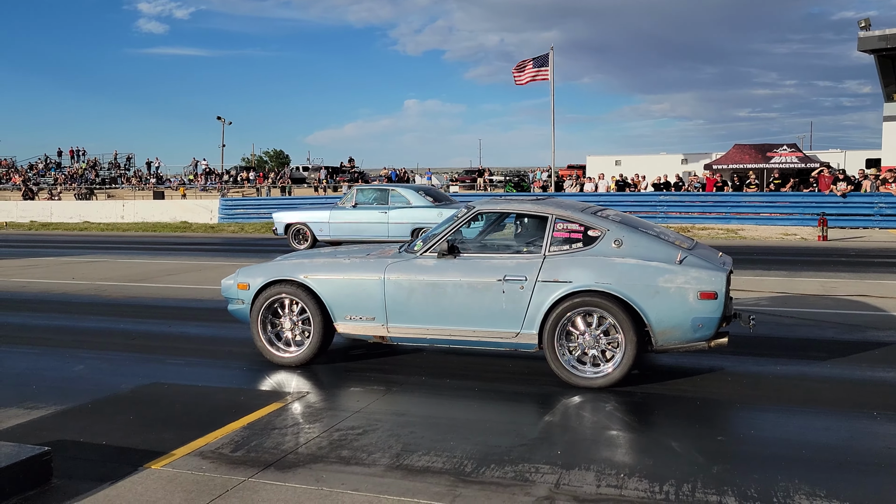I don't know. All right, so second pass at Pueblo, two step didn't happen. I still need to get that figured out. But I did only go to third gear like we were planning. Shifted at 6,700 RPM, 6,800 RPM there. Overall, I think it launched a lot better. There was no wheelie, but still need to get that two-step figured out. We dropped down to 1,300 RPM on that launch. So, see if I can get it figured out.